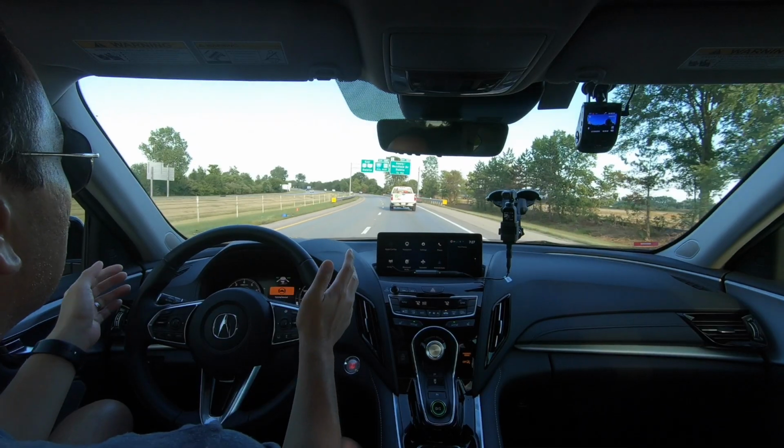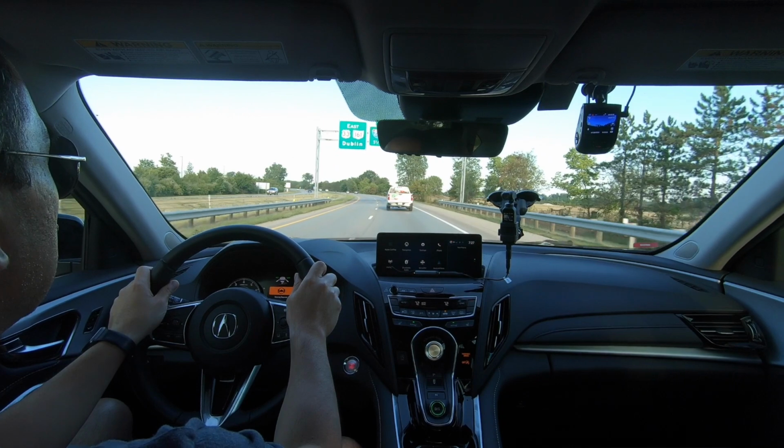And again, I learned something new today. I learned that once it starts giving you a warning saying to put your hand on the steering wheel, after about 4 or 5 flashes, it actually turns off the lane keep assist system. And you can see where the solid lines turn into not solid lines, just an outline. So it just did it again right now.